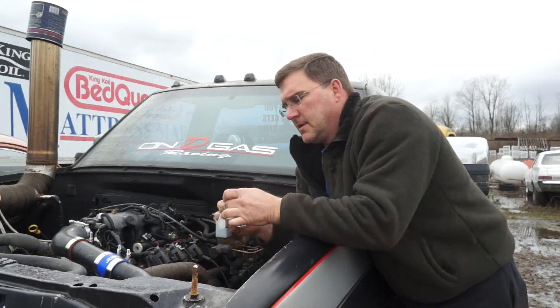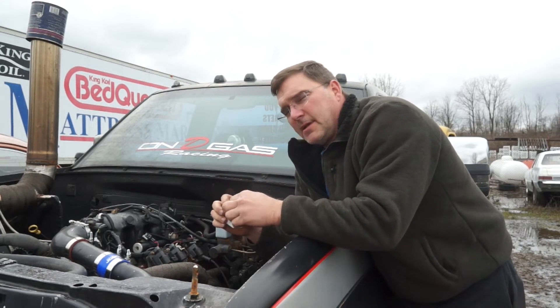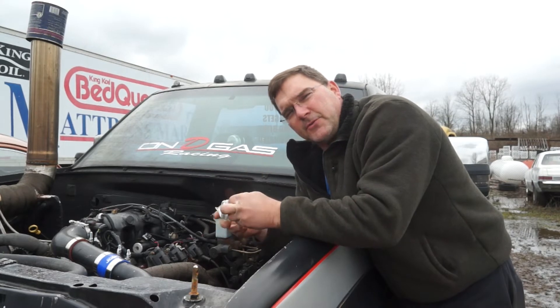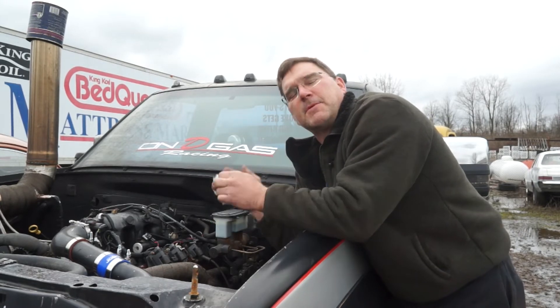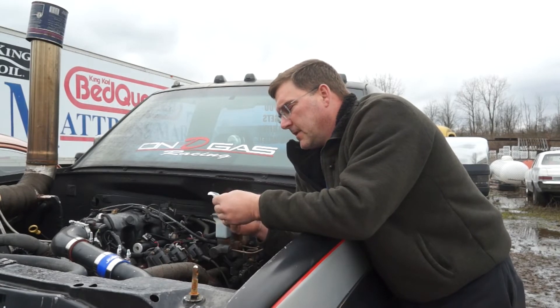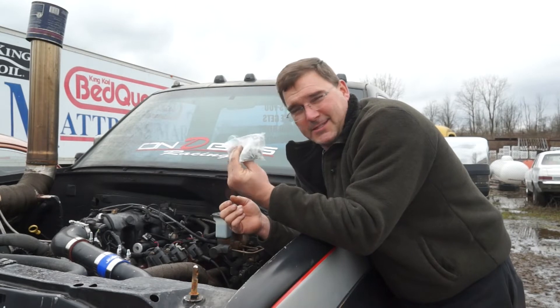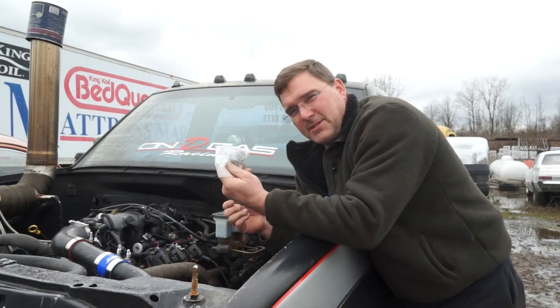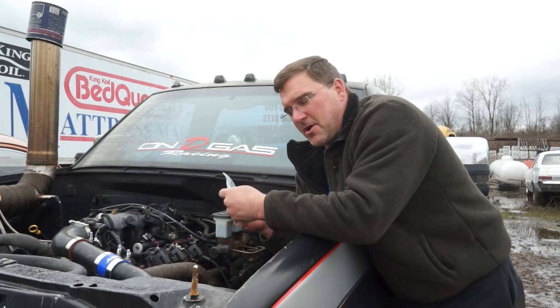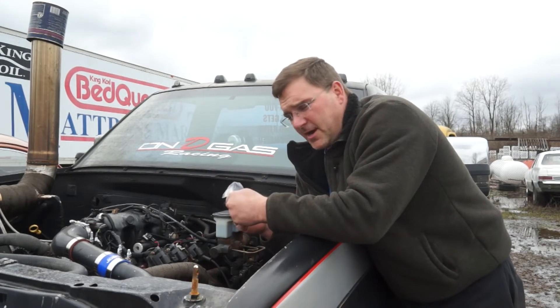If you don't have these clips, you end up with 60 PSI in the fuel rail and it'll push the fuel injector out of the fuel rail. Then you have a fuel leak and your car goes up in a ball of flames — nobody wants to watch their car burn on the side of the road. I hopped online and got a set of eight clips for like $6 delivered. These clips absolutely should be on your car from a safety standpoint.